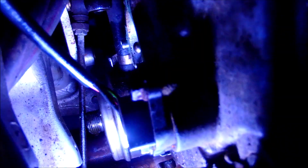One of the final jobs: I can just see the pushrod there. The pushrod needs to be lubricated with some high-temperature lithium grease. The service manual says apply lithium grease to that pushrod prior to putting the piston back up.